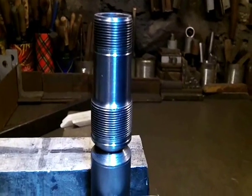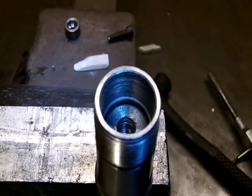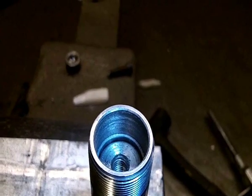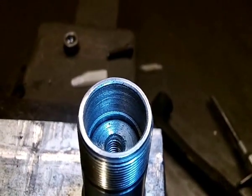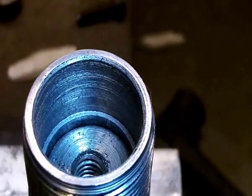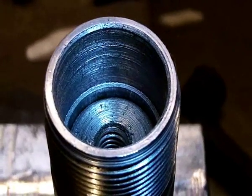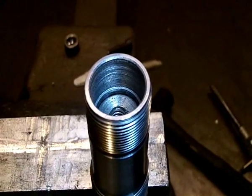Right, so that's it hammered completely to the bottom, so that the 2 chamfers are just ready to get welded. And here you'll see how the centre shaft just sits a fraction below the edge that I've turned into the old steering stem, and that allows the bolt to actually put a fair bit of pressure on it as well. So it's sort of doubly ensuring that it will never come loose in reality. So yep, that's worked exactly as planned.